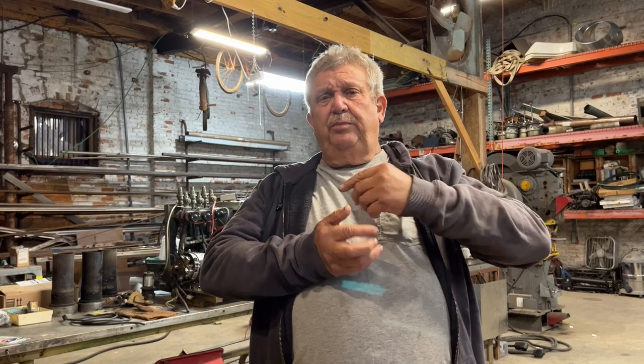So we were checking the door lock motors in the bay doors, which is a General Motors door lock motor out of a Buick or a Chevy — all the same, probably around 1990. It had power. There are two wires, and the way that works is you reverse the polarity to pull, and reverse it the other way to push. Something changes that polarity — but both our wires were hot. We need a ground and a hot to make them work, and you reverse that to go the other way. But both of them were hot.